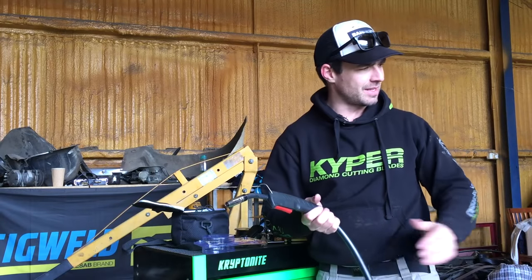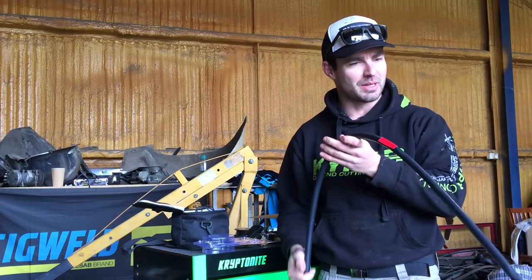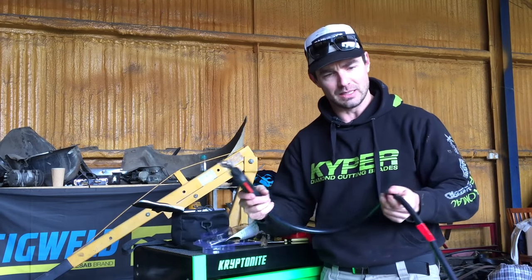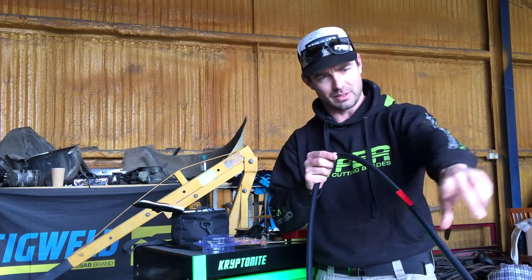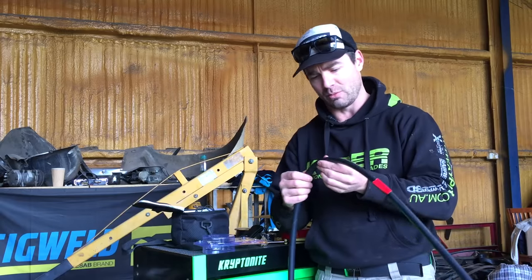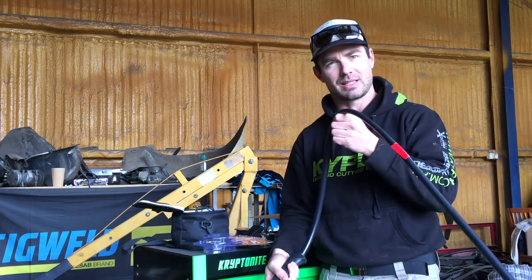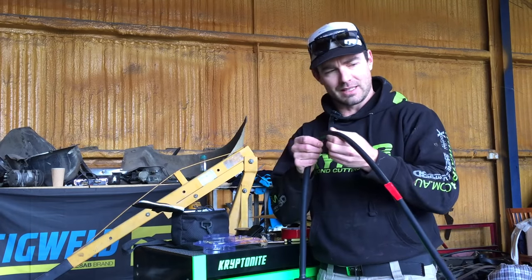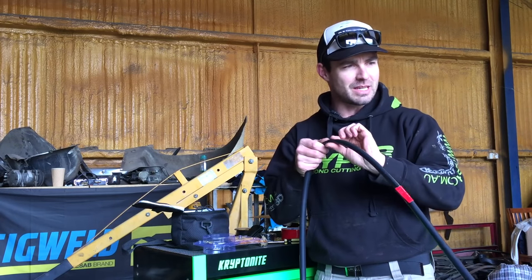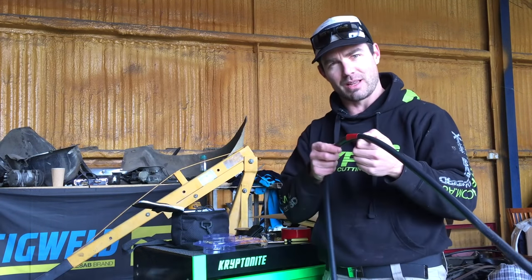In between these repairs I've been having a bit of a welding issue - I've been leaking gas out of this pipe. One thing you've got to look out for when you've got this lying on the ground is the little gas pipe is quite sensitive. With the weight of the gas tank in the back, if the wheels run over it on the ground or if you step on it, it can pinch that gas pipe and you start having a leak and then all your gas regulation will be stuffed up. Unfortunately this is a sealed unit so you can't really get in and undo it from the unit itself. So I've marked where I can hear it coming out.